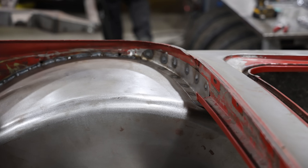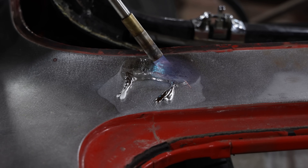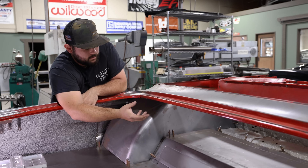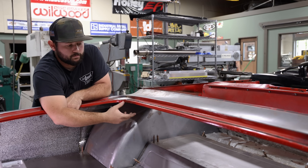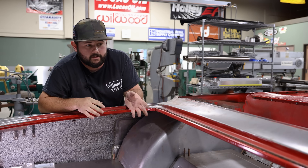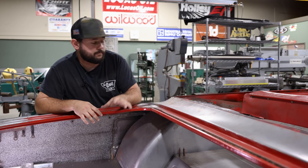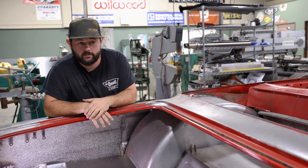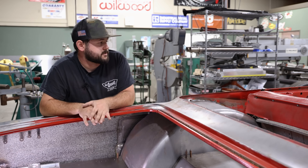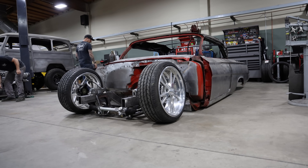On this backside, you can see we've added in a structure just to tie that tub in to this rear catwalk right here. While we were back here, we went ahead and shaved the factory lead seams — made some filler panels, got those shaved and welded in. What's going to happen is we're going to mount new hinges, Impala style, and we'll just be relocating them inward to fit with these tubs. These tubs are basically as high as they could go before having to cut into the quarter panel, which obviously we were not going to do. When this car is on the ground, it'll be maybe two inches off the ground in the rear. The owner was happy with that and we're excited to see how that goes.